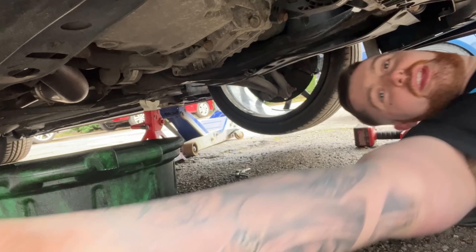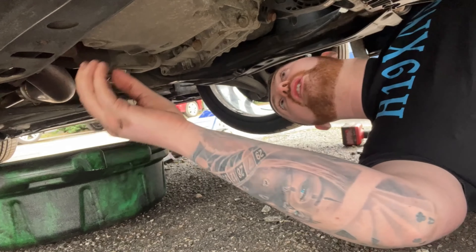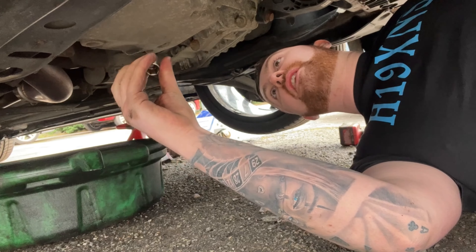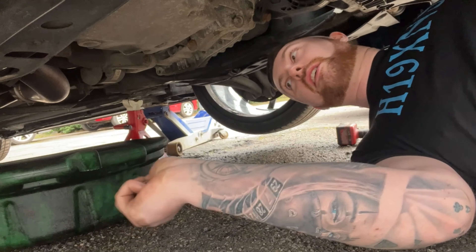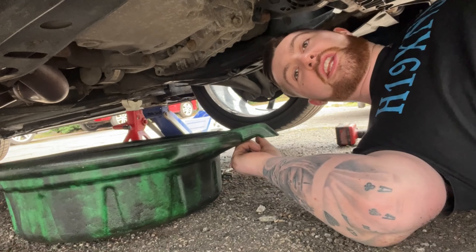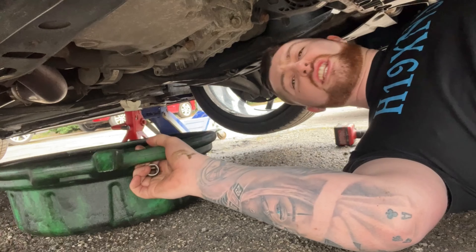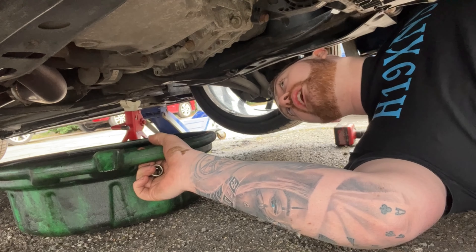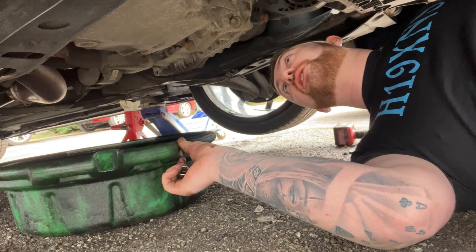Right, I'm back under the car. The sump plug is 15mm. You're going to need something big enough to catch the oil - I think there's about 6 litres in there. Put the catch bucket a bit further back. There are people out there who probably don't know how to do this. Most people go to the garage because they want their service book stamping, but I sign the book myself - as long as it's signed and I've got all the receipts, I see that as fine.